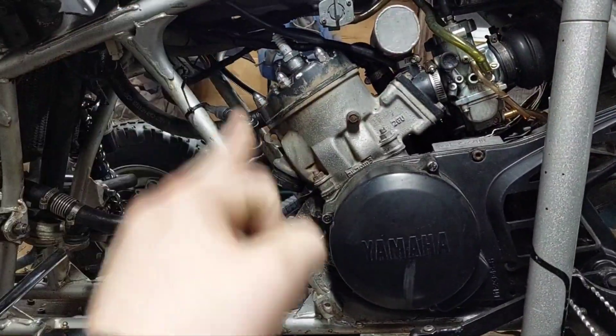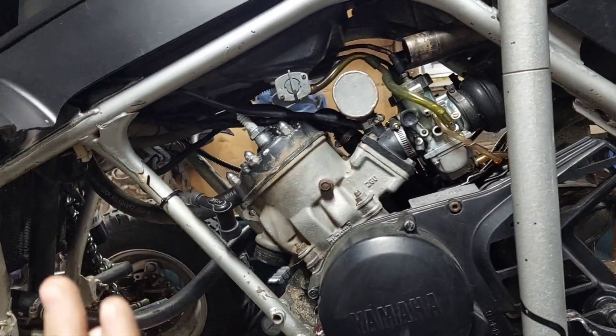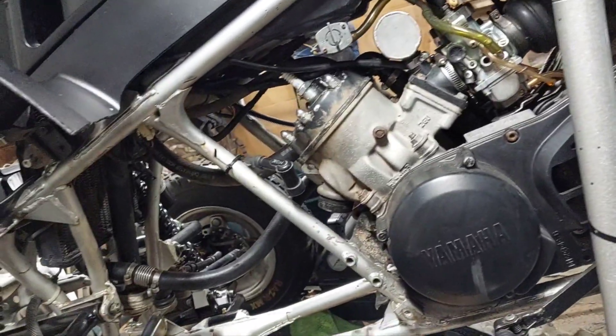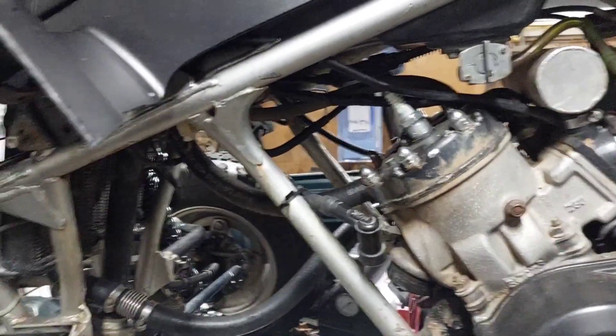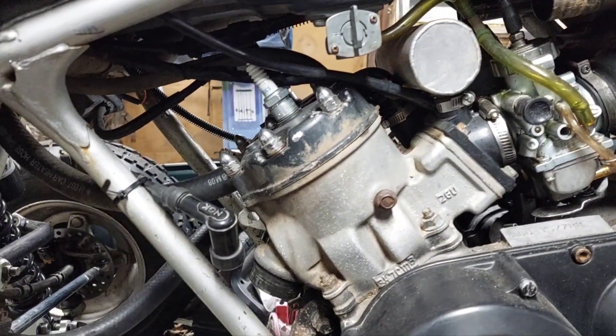I got the pipes off and I'm going to pull the head off so we can figure out what size it is and get a gasket for it. I need to measure the head. I'm going to get air filters — he just rigged it up, so I'm getting the two filters for the back. I'm going to take the head off tonight. Videos take a lot of time, so I'd rather just get the video done and then get back to work so I don't have to worry about recording.